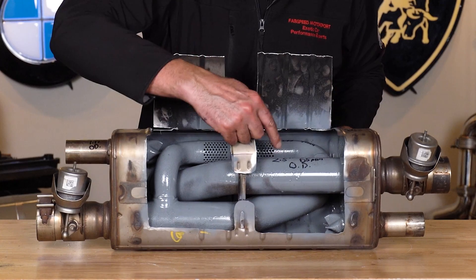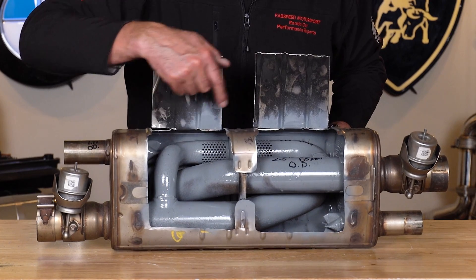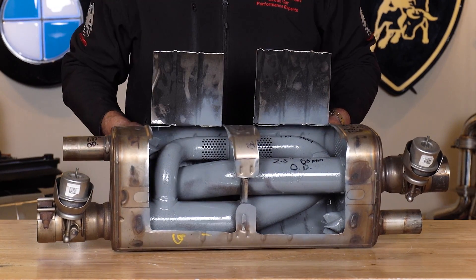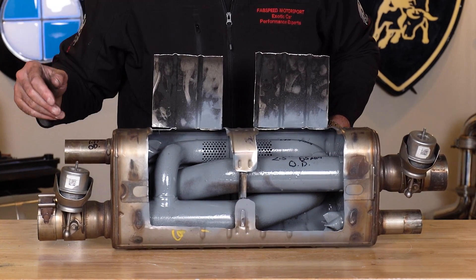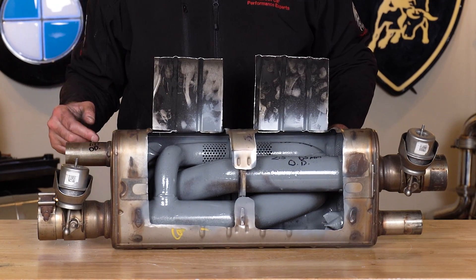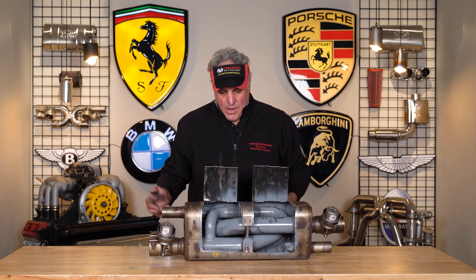Now as we look through here, this is a two-and-a-half inch tube — 65 millimeters — but they put a little balance tube in there, if you can see. It goes from top to bottom. That's Porsche's attempt with the factory sport exhaust to tie both sides of the flat-six together. This tube is only inch-and-three-quarters, 44 millimeters. You can see they have perforations here, and that's basically it — there's no packing in this muffler. I painted everything so you can see it.